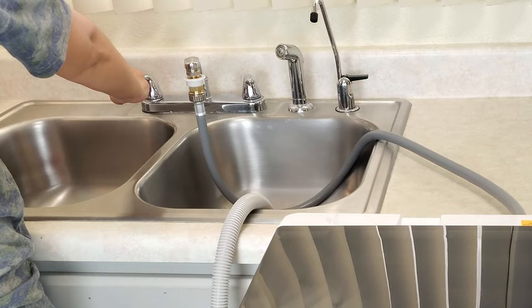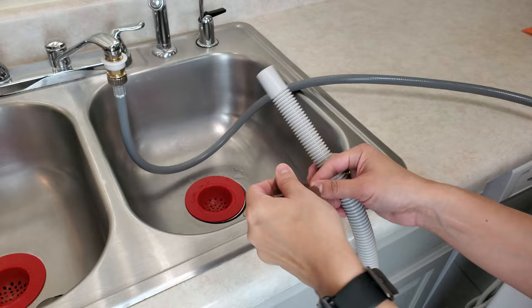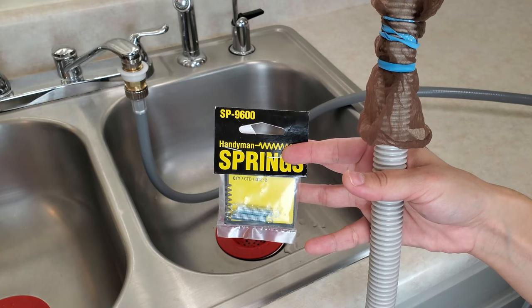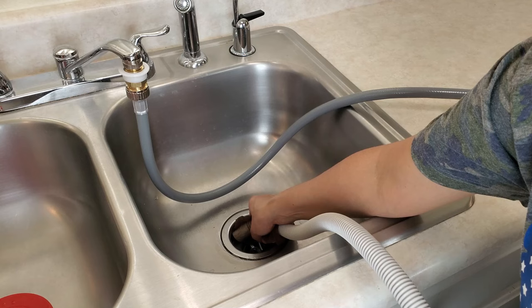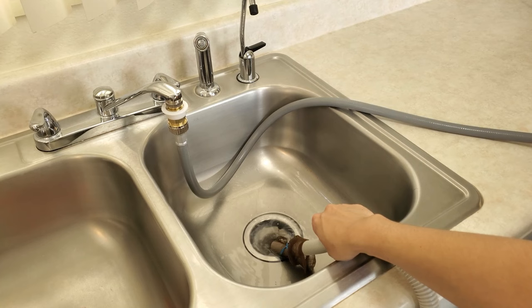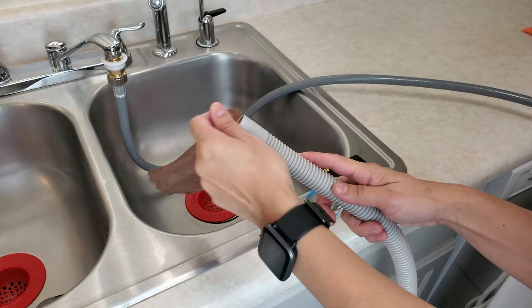Next is the drain hose. You'll want to make sure you put some type of lint trap attached to the drain hose because a lot of lint comes out and will quickly clog your drain. I've found that using a regular pantyhose stocking and a rubber band attached to it collects even the finest debris. You'll also want to anchor it down — I use a small bungee, because the water pressure when it drains comes out pretty powerfully. This keeps the water from getting everywhere and is a very inexpensive solution.